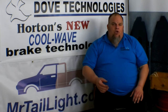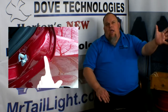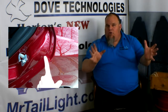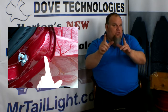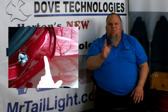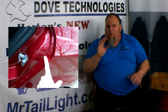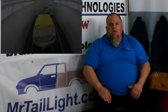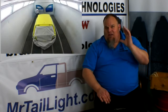One of the other things you can do is open the doors, open the hood, open the trunk, and run your hand along that edge. If all the edges on your doors, trunk, and hood feel nice and smooth like the outside of the car, it's never been in a crash. If you run your hand along there and the paint looks a little dull and gets sandpapery, that's overspray that got down in the cracks because it wasn't prepped properly — a big telltale sign it's been painted again.